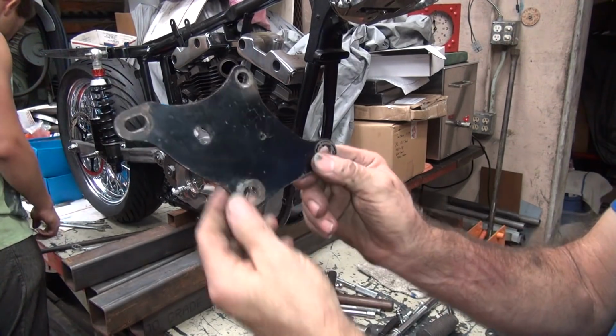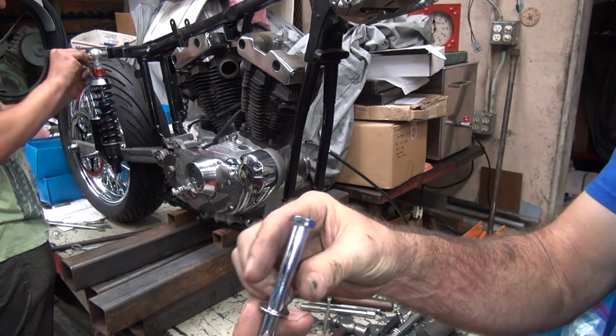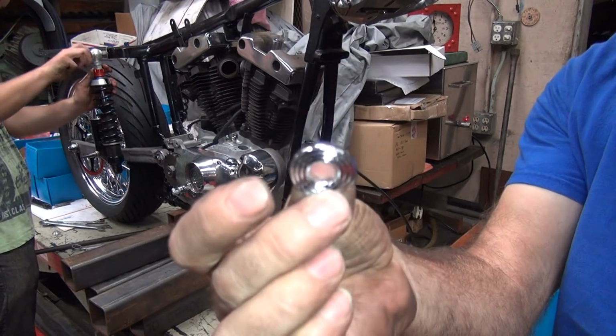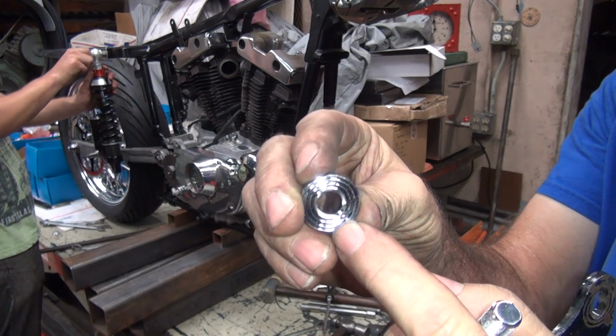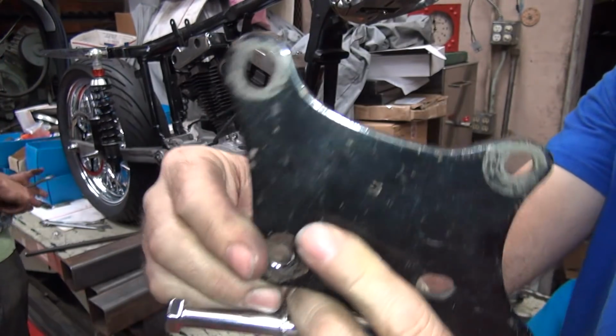Okay, here's our motor mount. So we have big holes and small holes. Small holes means you use small washer. Big hole means you use big washer. 3 turns, you said? I don't know. You have to just measure it. So this here is the serration, which keeps it from moving around over these big holes. Kind of like locks them in.